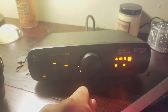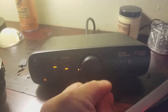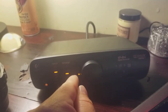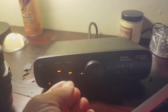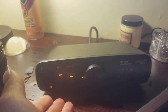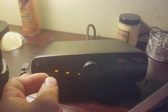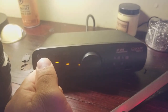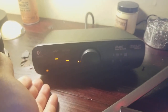As far as I could tell, if your system is locked up, remove that little cover panel from the bottom of the control unit, short the pins in pairs while the power is off, and your system may come back up. That's what happened to mine. I went through about six months' worth of forum posts and nobody has mentioned that. So if your Logitech Z906 speakers are not working, try what I just did — that might fix it for you. I'll post back if I have any more issues.